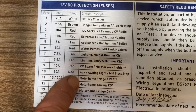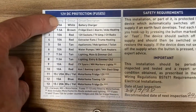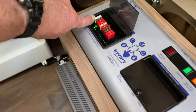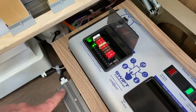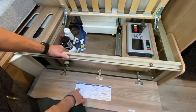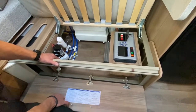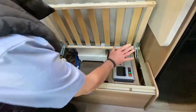If it's 13 fuses, you're in a motorhome — the last three are all to do with motorhome use. Number one is a 25 amp fuse, white in color, and it serves the battery charger — we've got a green light on next to it so I know it's working. The rest of the distribution just tells you what each fuse feeds within the caravan as you go down the label. It's easy to remember — just one to ten, as we've only got 10 fuses in that housing.